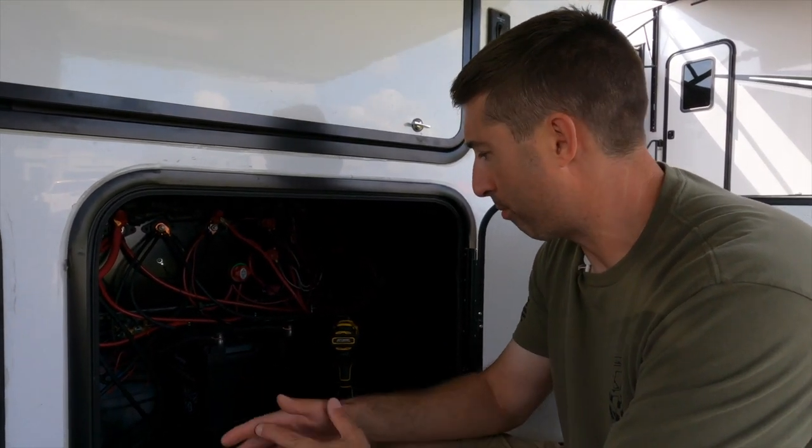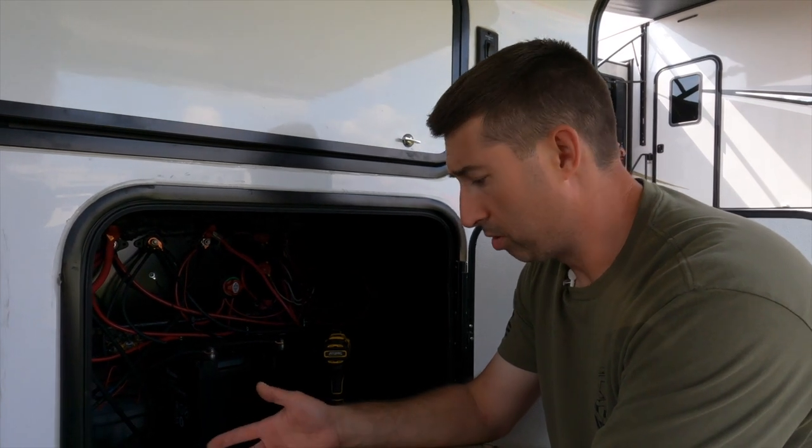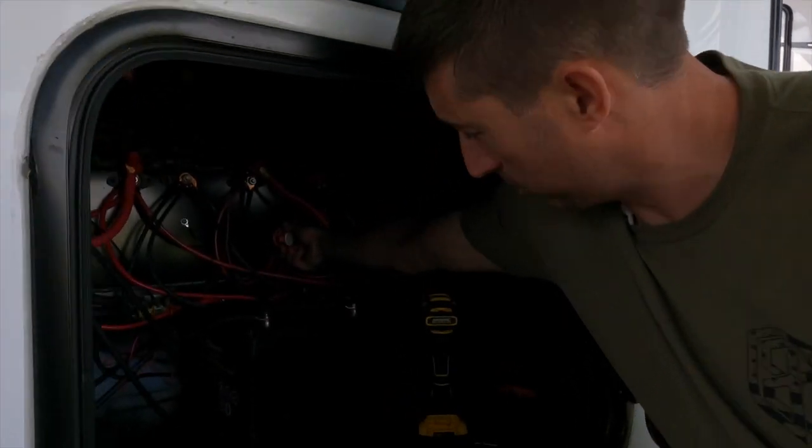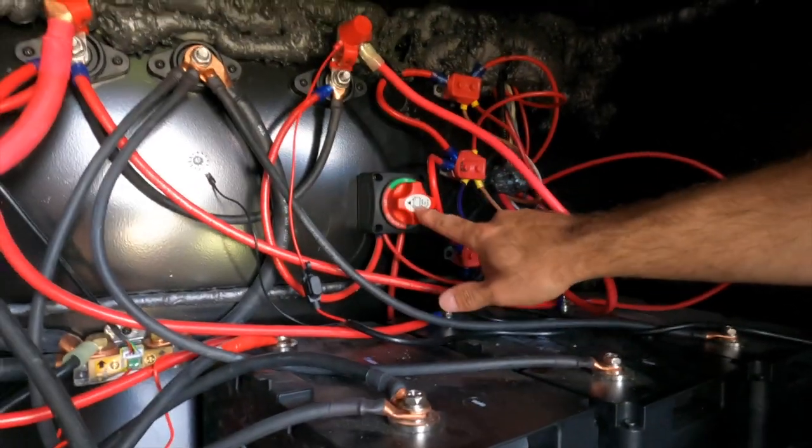Now that we're set up and the bracket is removed, ready to install. Two things you need to think about at all times when working on batteries: always, always, always connect your positive before your negative. Make sure your positive wire goes on first before your negative. Before you even get to that, make sure you kill the power. We have a battery kill switch here so I'm going to turn it to off, then have Martha go to the power station and turn off the 50 amp for the trailer. For a little while we'll have no batteries and no power, then it's safe to work.